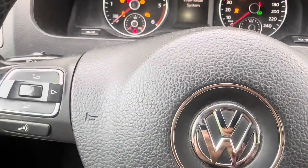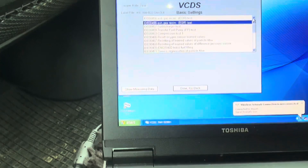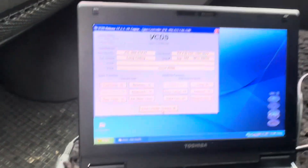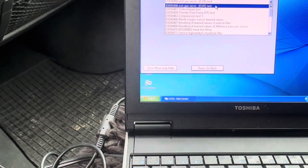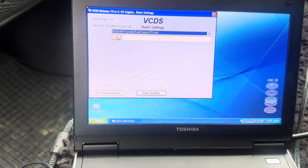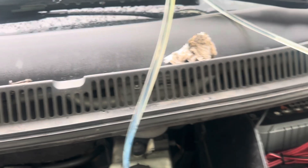Okay, ignition on — don't turn the engine on. So I'm into VCDS. We'll go up to engine, then basic settings, and if you look at the tests go down to tests — you should see 'transfer fuel pump'. Go to transfer fuel pump and just go. You need to do that probably once or twice, about 30 seconds and you'll get your fuel back. I'll do another quick one just to show you again — basic settings, transfer fuel pump. I'm going to press go and as soon as I do that I'll switch to the pipe, and as soon as we see fuel there we can turn this off. Right, she's running now — there you are, fuel. Okay back to here, done, go back. So there's fuel there, up to there.